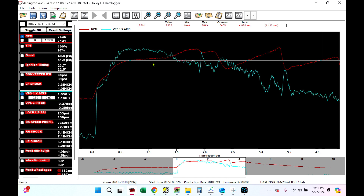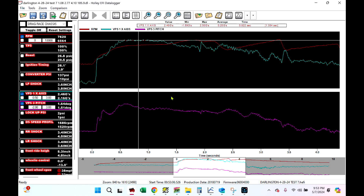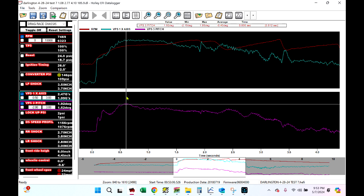So I use a VPS. I've made other videos on the VPS — this isn't a sales pitch to try to sell you one. But the G meter is extremely important. It is telling you how fast you are accelerating forward. So you tune via the G meter. Once you start tuning these things and getting really fast, you will start tuning with the G meter. The VPS is nice because it not only gives you X-axis G, but it also gives you pitch — that's the angle of the car. If you want to learn more about the VPS, go into my channel and you'll see plenty of videos.